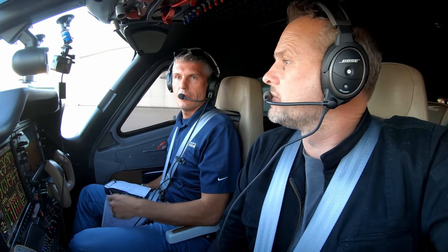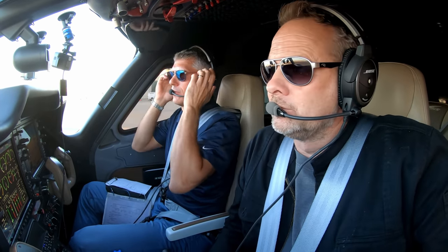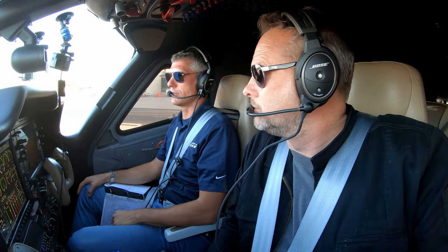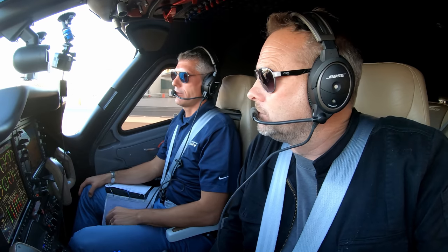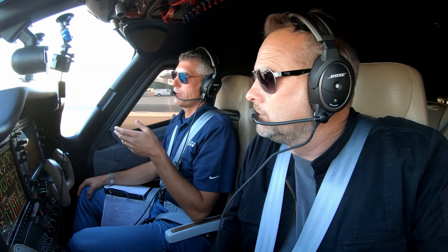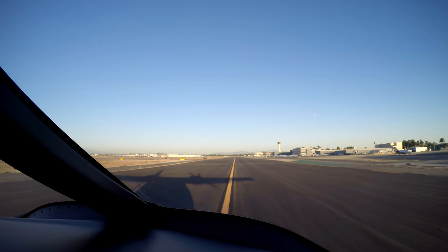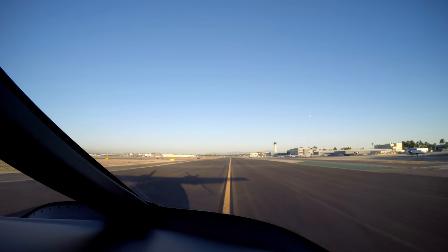I got controls. So, while taxiing, one of the advantages of the TEO540 is that the electronic engine can make the run-up by itself. We don't have to do any magneto check, mixture check, everything is going to be taken care of by the engine electronic control system. Now, in order to do that, we can either go to the run-up area, push power somewhere around 15 to 1700, and push the two black buttons on the EECS control panel. That's going to do the entire run-up.